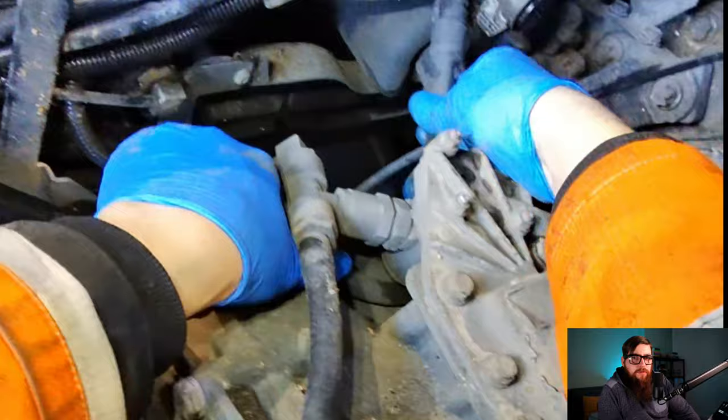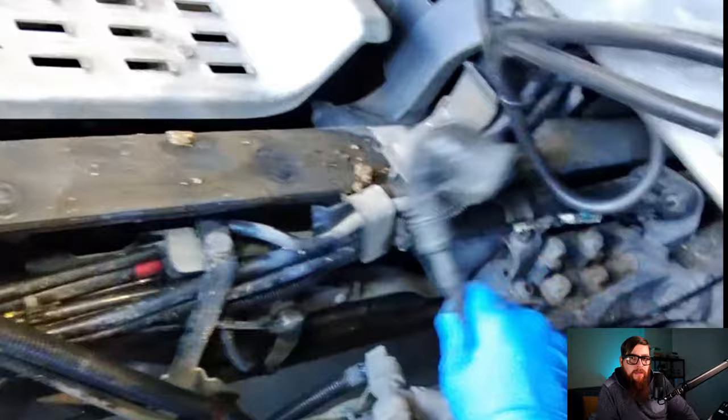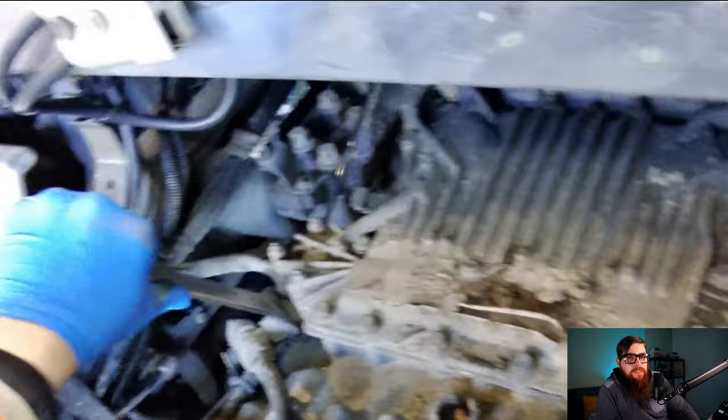This plug on the left of the modulator — if I can get the loom off from under the air pressure regulator — contains the transmission connections and runs down to the clutch actuator and the vehicle speed sensor. The last thing we need to deal with before we get to the bolts that hold the modulator to the gearbox is the air supply.